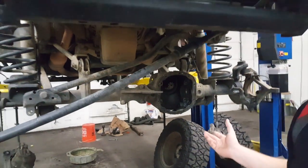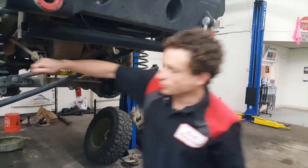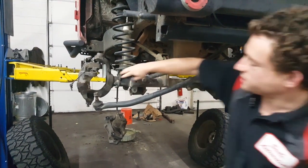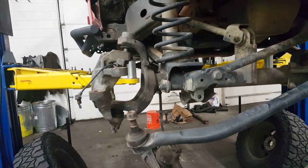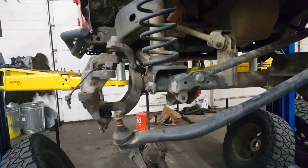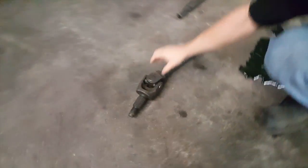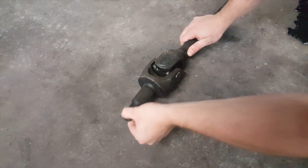Now, in the case of this vehicle, the axle shafts then pass through the knuckles themselves, which is what steer the vehicle side to side. In this pocket, that shaft must bend and twist. As a result, there are U-joints, a universal orbital joint that we would typically see in a drive shaft or similar configuration to allow rotational motion.